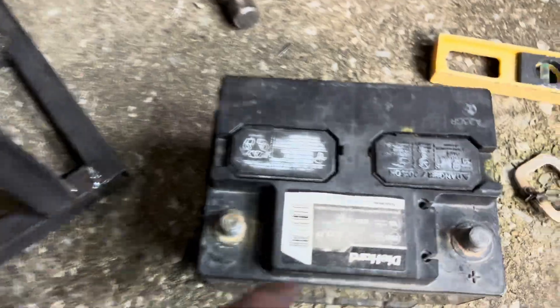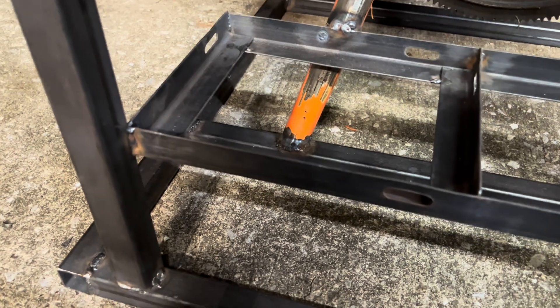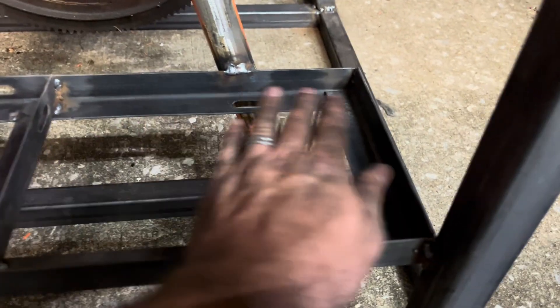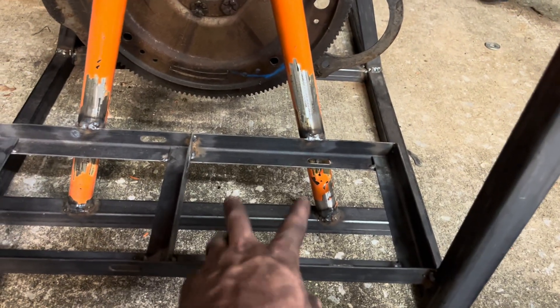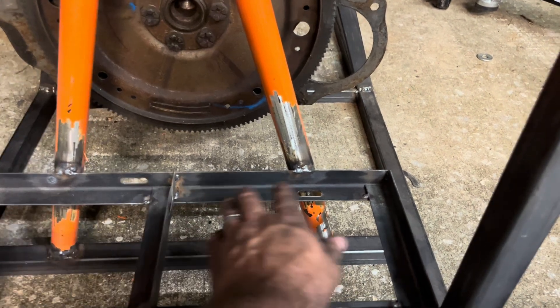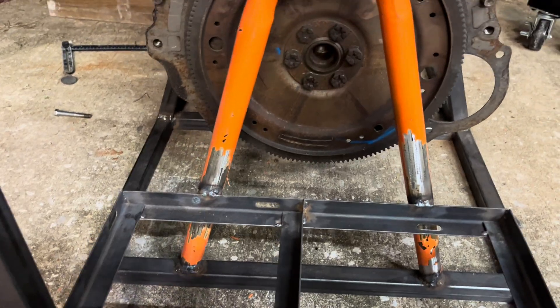Going back here I decided I would use this style battery. I've made these little L-brackets out of some angle iron I had and put it about six and a half inches to the top from the bottom — this fits that battery perfect. This is where my battery box is going to go. I'm going to put a flat piece of steel in it and this is where I'm going to be mounting some of my wiring. I thought about putting the solenoid down here — we'll just have to wait and see. There's my battery.